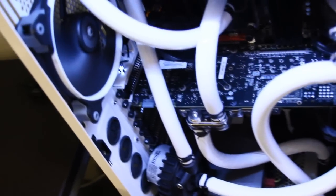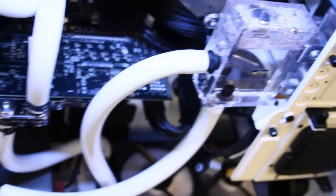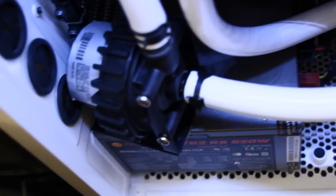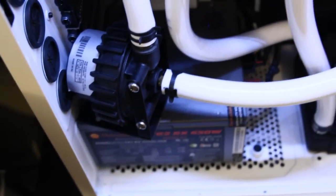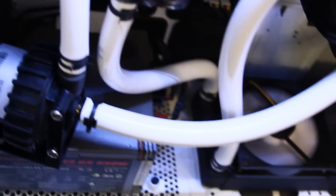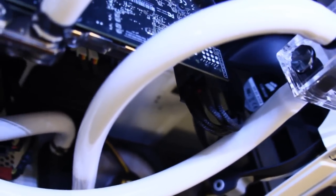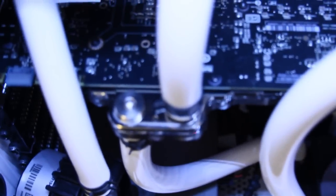How do you know water cooling is for you? Well, water cooling can be for everybody, but it's definitely recommended for those people who want to achieve the maximum overclock they can out of their processor or live in a hot environment. Water cooling isn't necessary for people who are not overclocking or even people who are doing mild overclocks, because there are plenty of high-end, high-quality heatsink fans out there that offer just as much cooling capacity as some of the lower-end kits.